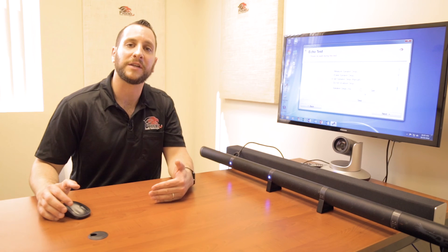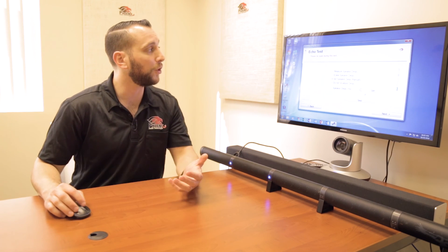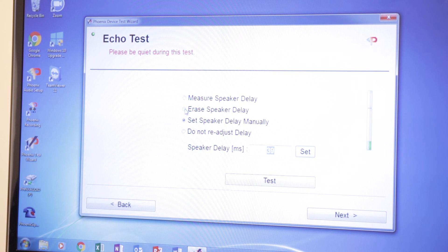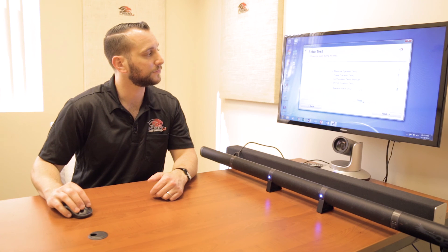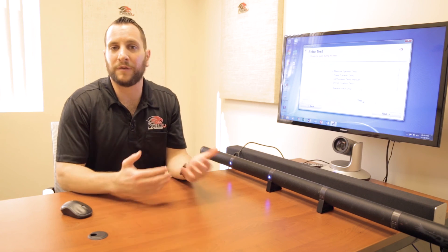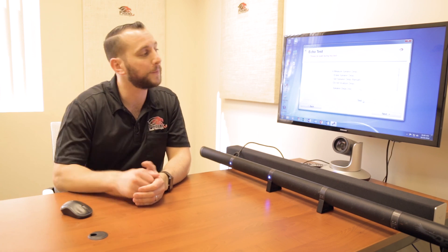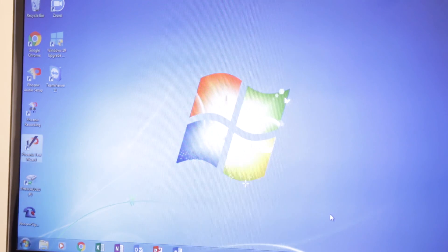If you missed that first chirping test — if you didn't plug in the sound bar at the right time, or you moved your Condor to a different room — you have two options. You can either erase the speaker delay, and the next time you power on the Condor it will run the automatic test again as if it were brand new from the factory. Or you can click 'measure speaker delay' and do that test right now. So we ran it and it actually measured 50 milliseconds. Anywhere between 40 to 50 milliseconds doesn't make a big difference — the echo cancellation works. The time delay is set and the product is good to go. Once we're done, you just click next, save settings and exit, and the Condor is set, installed, and ready to be used.